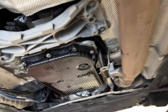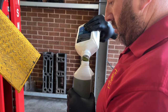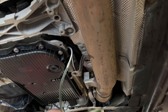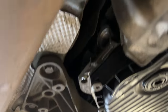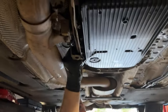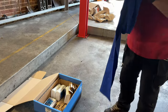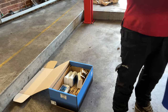Pan is on — now we need to pump the fluid in from the side plug. The new oil is a completely different color to what came out — it's supposed to be green, not dark and dirty. We only had a little pump to get seven liters of oil in, so it took quite a while but it did the trick. It was leaking after three liters — they say it needs seven but there's still going to be a liter in the gearbox, so about six. Start it up, put the sump plug back on, get it warm, bang it through the gears a few times.